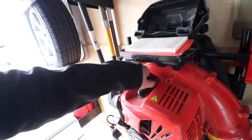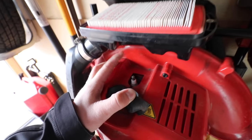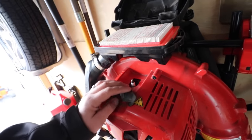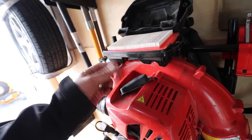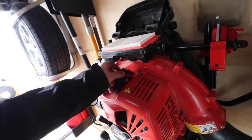Some people take compressed air and just blow the filter out, but for $20 it's a good investment to buy a new filter. To change out a spark plug on a two-stroke piece of equipment is fairly simple. However, pretty much all the spark plugs I use for this equipment are on national backorder, so I can't show that today. I can show you where the spark plug is located — on this blower, you use the spark plug removal tool to pop it out and drop a new one in. Don't let your fingers touch the internals — you don't want any oil or grease on it. Change all that stuff out at least once a year.